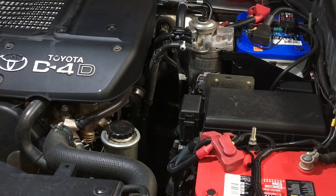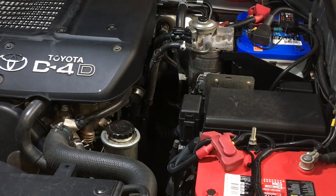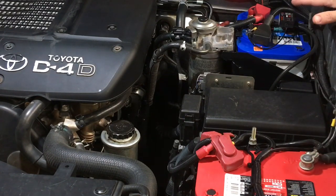You don't need a bigger battery because generally you're driving the vehicle each day — even just 10 Ks to get firewood or swim at a waterhole. The Optimas recover really quickly. Other battery types without spending a lot of money — half an hour driving might only get you another 10-20% charge back. With these, 10-20 minutes and the battery is at 90% plus. It's amazing how quickly they recover.